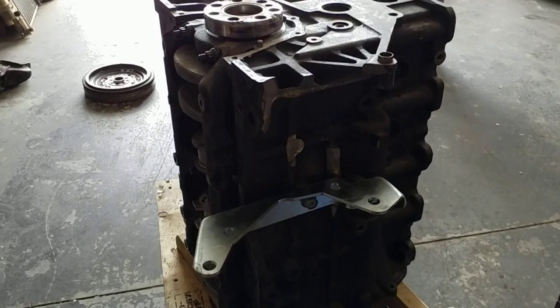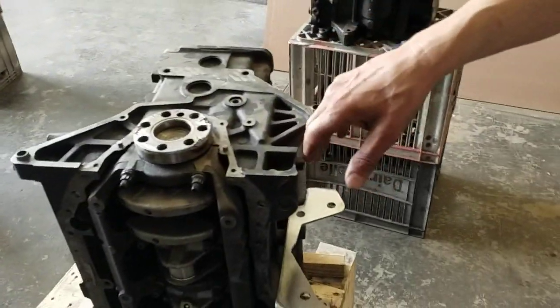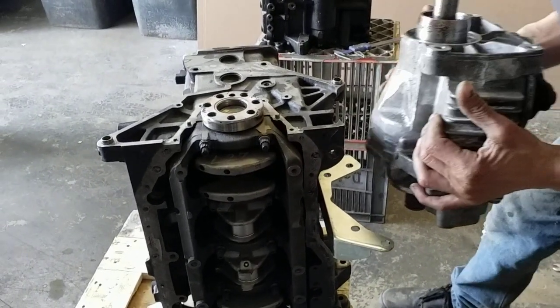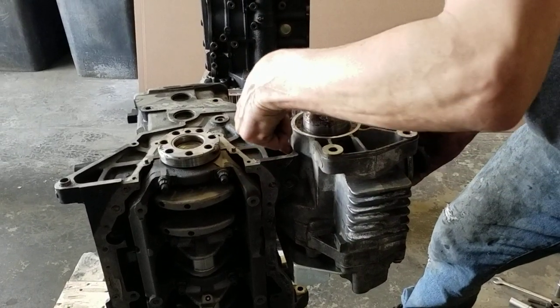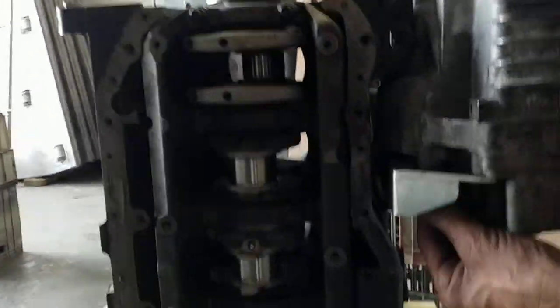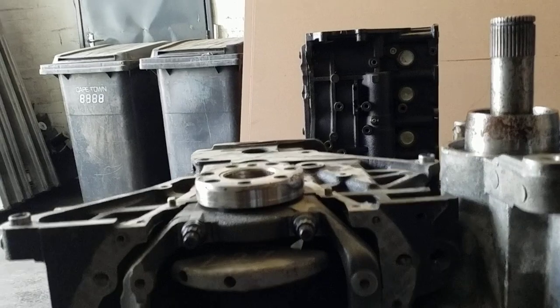The next thing you want to do is fine-tune that cut on top that you did earlier. Once the transfer bracket is on, take the transfer case, lay it on the bracket, and start to slide it backwards. You'll find you'll have to just fine-tune that cut until the transfer case goes all the way back and the four holes underneath line up — basically until you're able to get those bolts in. Once the bolts are in, you know you're basically clear. Turn the bolts in by hand because the holes are oversized in the bracket.